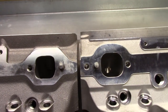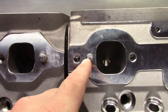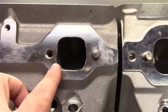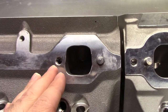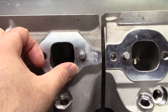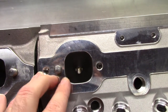Next let's compare the exhaust flanges. You can see they have widened the flange around the exhaust port compared to the old casting, which is narrow on the bottom. I like when they do that, because using a tool to clean up the old gasket sometimes you can damage a narrow flange easier — it's just extra safety in my book.